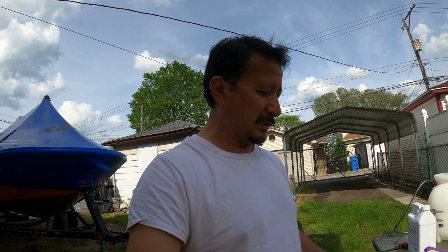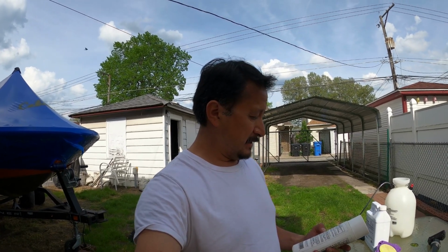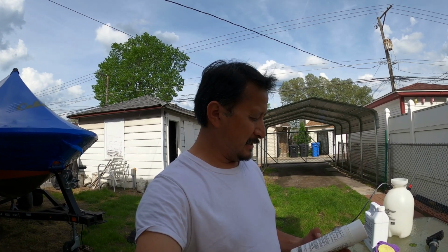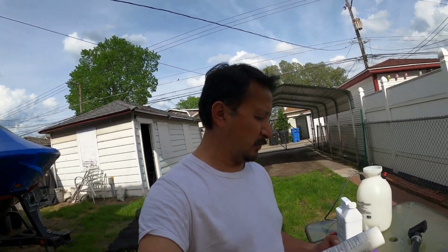I want to know, do you need two coats? I know you need the two coats. I'm trying to see what's the time that you gotta let it cure. I know you need a cure time also, so if you're gonna put your boat in tomorrow, I mean, you could wax it tonight, but it's supposed to have a 24-hour cure time. It says use a damp sponge or cloth. Let dry, just let dry and remove the haze. Apply second coat after 24 hours and allow to cure for 48 hours.